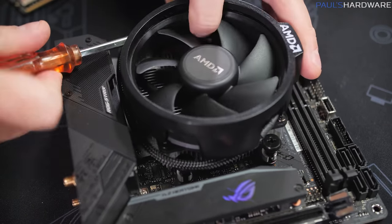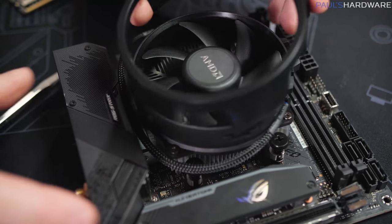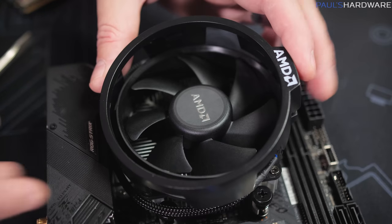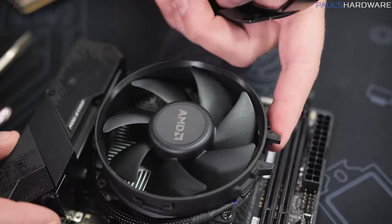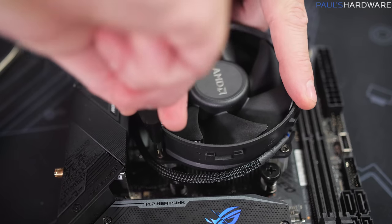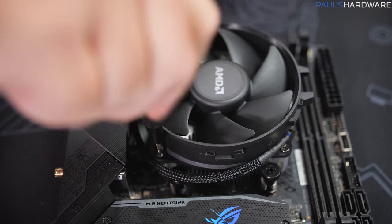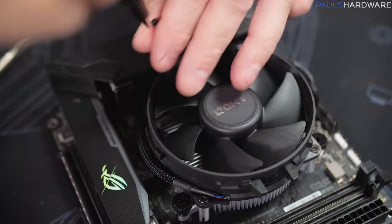There's just a couple plastic catches that sort of snap around the outside here that allows you to pop that off. It would be convenient to just pop this off, rotate it 45 degrees, and snap it back on, but we actually have to rotate the entire fan unit that's underneath it. Fortunately, that's only held on by four screws, so we're just going to unscrew those, then we'll rotate it 45 degrees, and then we will screw it all back down.